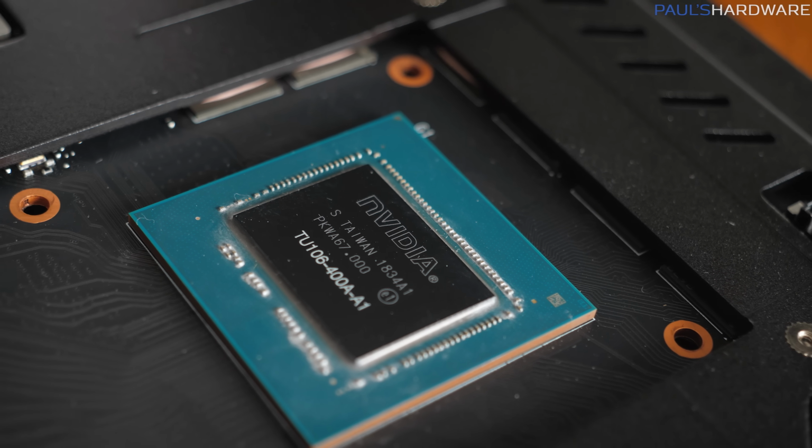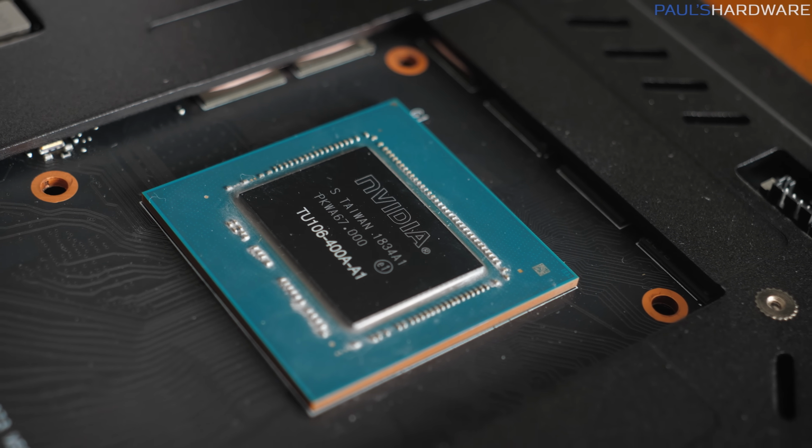So what this indicates to me is that, well, obviously the GPU isn't able to run through the test successfully with the frequency it's running at right now. I don't think it's a temperature issue, and it might potentially be an issue with the power delivery to the GPU itself, or just the GPU ASIC quality itself, which would indicate that it's good that I'm doing this video, because that might seem to indicate that the TU-106-400A dies can potentially overclock a little bit better. I can't say that with too much certainty because I've only tested 2 cards against each other, but perhaps others who have these cards will come out and do some similar testing so we can get a more accurate picture of what we should expect when it comes to the 2070.